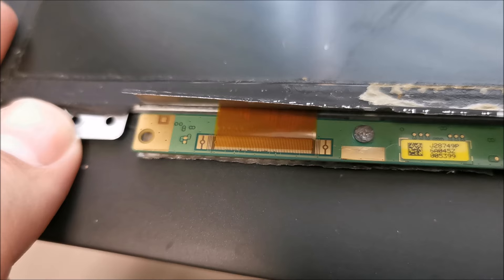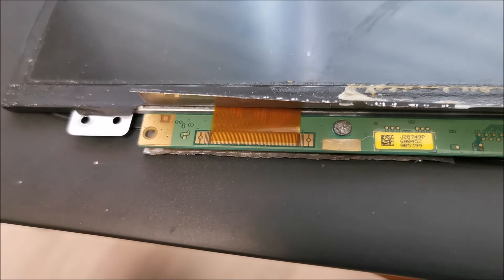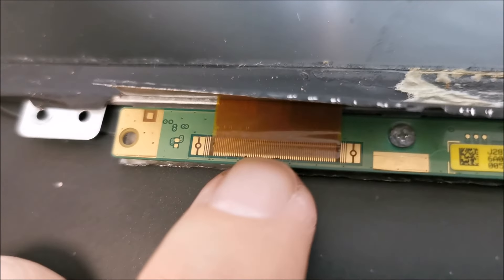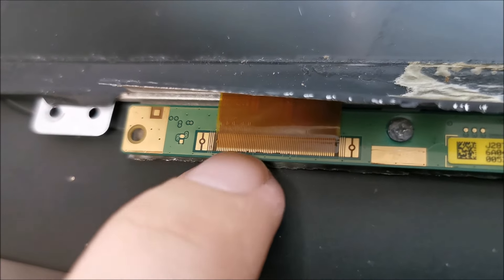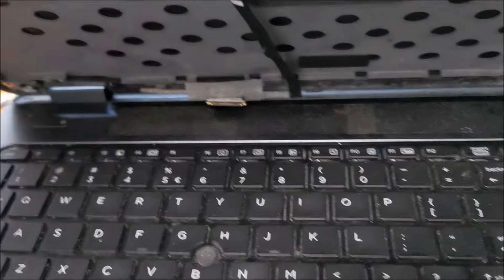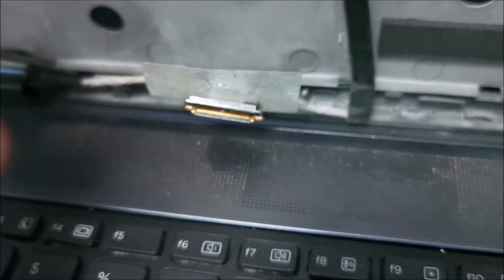Story time. While trying to power it on, I saw a quick flash. Then I instantly powered it off, looked around — nothing. Looked a bit better. Do you see? These contacts are shorter than they should be. So basically corrosion has gone inside of this board, probably shorting some layers. This thing doesn't power on anymore. If I look at the pins, we can see this pin right here — the second one that overheated. Probably some kind of power pin.